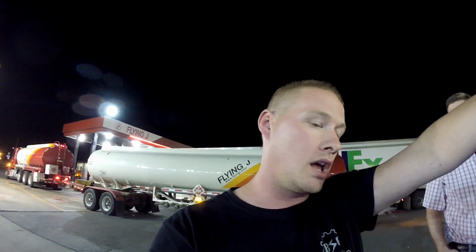No misfires at all on the Mode 6 data. I didn't drive it yet. Then I pulled codes for it, and it has a code for a P0299, which is underboost. It's the general underboost code and it can come from either bank. It's always watching the amount of boost, and it has a minimum and a maximum threshold. So I got that, and that's interesting in itself.